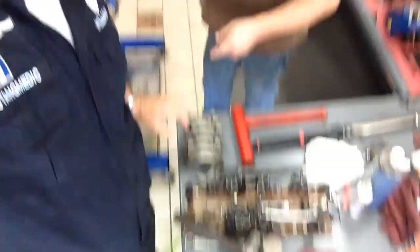This is part two, and we are talking about Will's word of the day. What are we talking about, Joe? Checking the clearances on Oscar's main bearings. So what he's done is he's clamped down the main bearings — torque on the main bearings is 70 pounds. He's now taking them all off — here they are — and we are now going to inspect and come out with clearances.